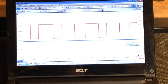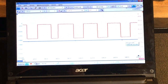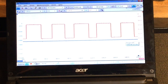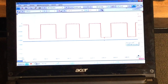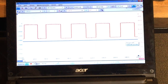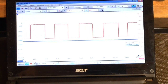So you can see, let me put the headlights on again, and I'll put the rear defroster on, put the blower on high, and keep an eye on the duty cycle. The low side, the negative duty cycle of the channel B, the red line, and keep an eye on the blue. I think once the red line actually matches, the blue goes back to the null, the no request, if you will. I hope that's making sense what I'm saying here, boys. I've got a blizzard actually blowing in my garage here, so if you see snow in front of the camera, yeah, it is actually snow, my dandruff, although that is an issue as well.